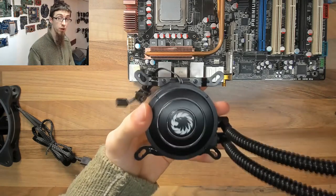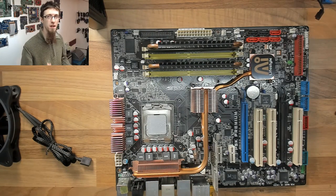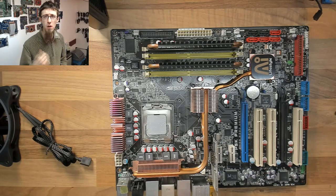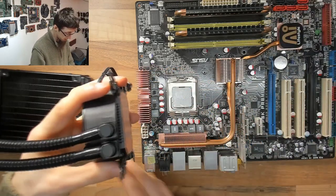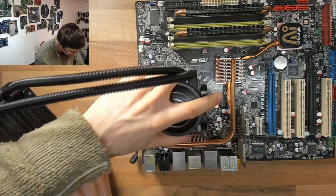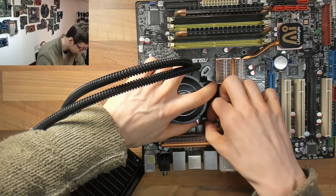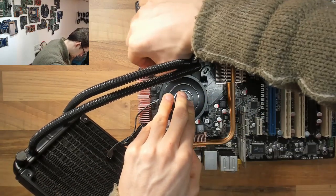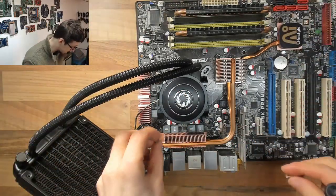Now our Intel brackets are fitted, we're ready to put it onto the CPU. Normally I'd recommend having your motherboard already fitted up inside the case before fitting a water cooler. However, since this is just a demonstration board, we're fitting it on the bench. Make sure you've got the long stepped M3 screws at the ready. Apply some thermal paste to the top of your CPU, then hold down the pump head on top of the chip. With your other hand, just drop in a couple of screws on opposite sides, and once those are located you can let go and easily put in the remaining screws.